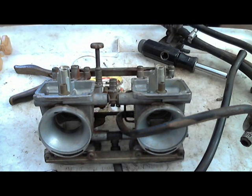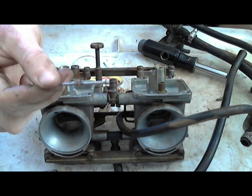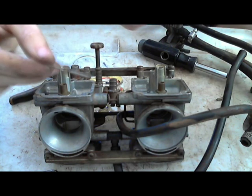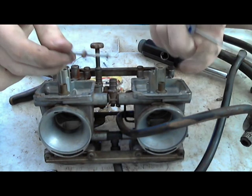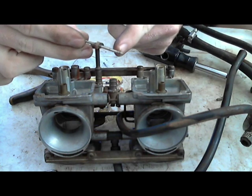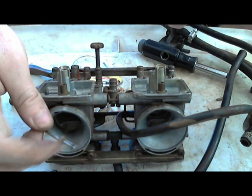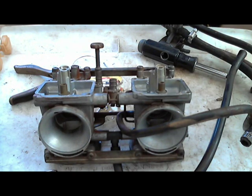And if you're buying this off of somebody else, you want to look at what it is. Does it have a needle like this, or does it have another one, which is not an aftermarket one, which is the stock one? Those don't have these little C-clips. It's kind of built into, how do I explain it, the way when it's molded, there's a lip here instead of a C-clip. So it's possible that these are stock, but I've never seen stock ones that had a C-clip on it and had these little grooves where you can adjust it individually. These are most likely the needles that came with a rejetting kit.